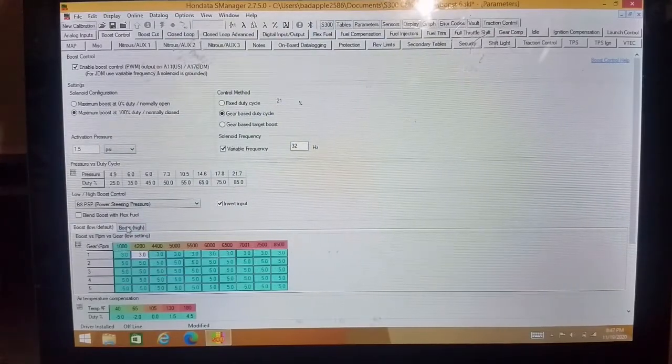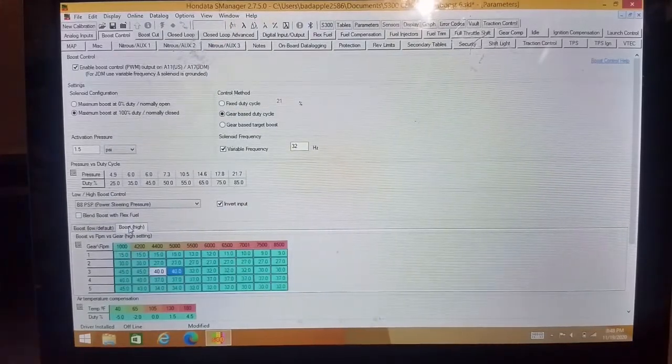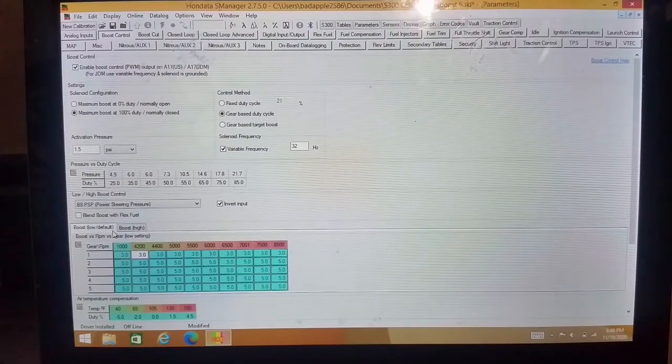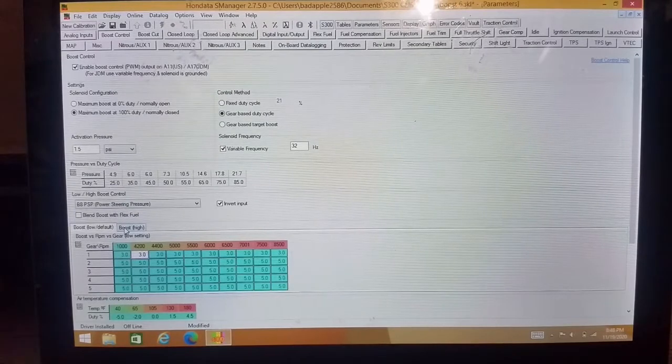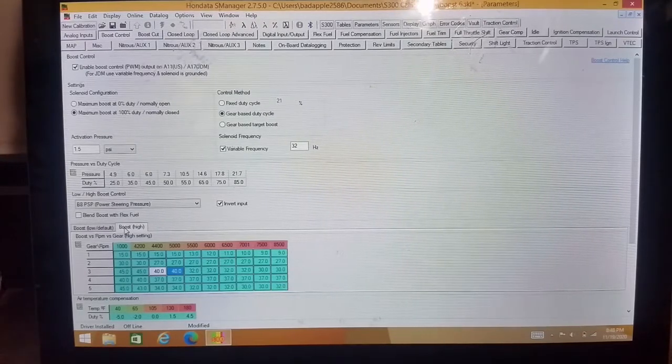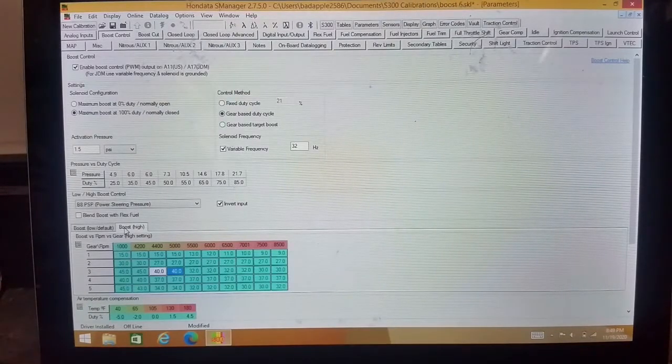Anyways, so you have high and low boost here. Mine is set to a switch that is on my shift knob. So basically, I'm going down the road, and I like to drive my car on wastegate, believe it or not. Sometimes it's not fun to have unusable, ridiculous power. So I like to use it on the wastegate so I can go around and rip through the gears, and I don't have to worry about it, and I can enjoy the car for what it is. And then say Mr. GT Mustang pulls up, and I don't want to have to worry about hopping in my computer and changing things. It's right there on my shifter. I come over, and once I press that button, bang, it goes over to the higher table. And now, instead of it making 6 or 8 pounds, now I can have whatever I want filled in there, and the car will respond.